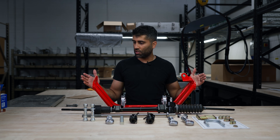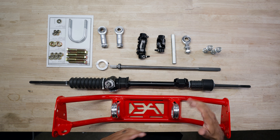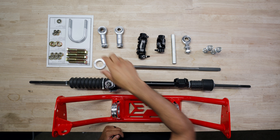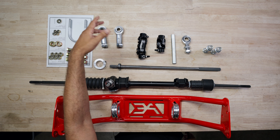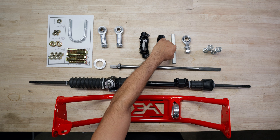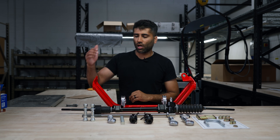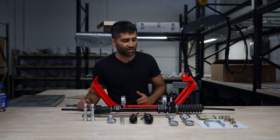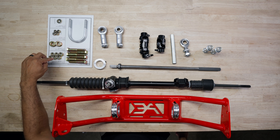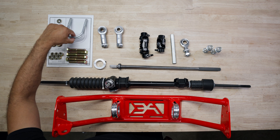In this video you'll have the steering rack crossmember, a pair of the upper and lower rack clamps, the shaft for the steering column conversion with the bearings and snap rings assembled, the aluminum clamp collar, a pair of the tie rods with the bung adjuster nut to make toe adjustment super easy, the double u-joint, a single u-joint, a three-quarter inch double D shaft, a rod end — this usually comes assembled onto the crossmember from us — and a pair of tie rods whether low profile or adjustable, whichever you selected. The hardware sheet comes with six half-inch bolts, six nuts, twelve washers, four smaller nuts, four smaller washers, and a pair of u-bolts.